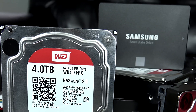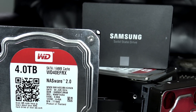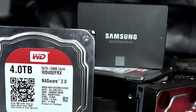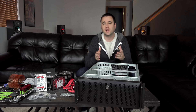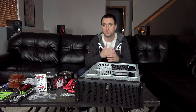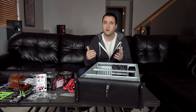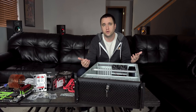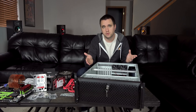As for my boot drive, I have a Samsung 850 EVO. I went with an SSD because I know I don't need Windows to run fast since this isn't a daily computer. However, I do need the speed of an SSD to allow the transcoder to have no bottlenecks if it has multiple transcode sessions. You can get away with a standard hard drive if you don't have high usage, but for my needs I went with an SSD just to make sure everything runs smoothly.